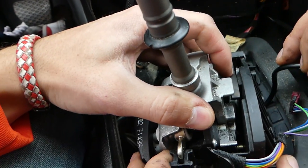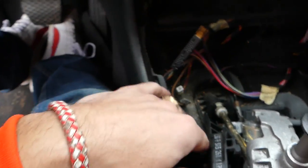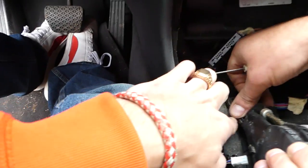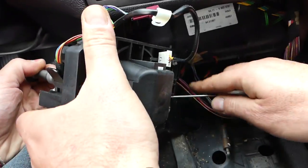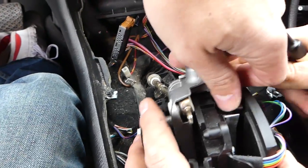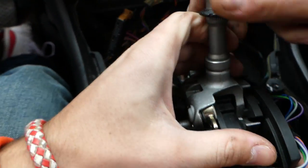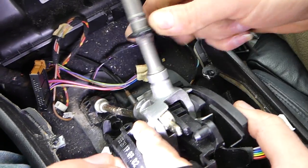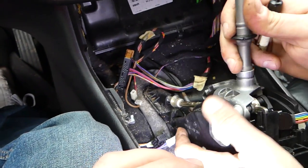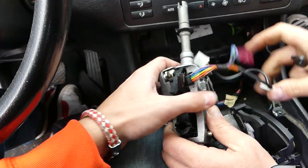Hold on — we still need to remove the cable from here. You'll need to bring it up because it's holding a little bit. Get that rubber grommet out of there so the cable can go up. It's important to push that tab in here — look at that — so when you pull it, push that tab in, then grab the shifter and pull it toward the back, then pull it up.